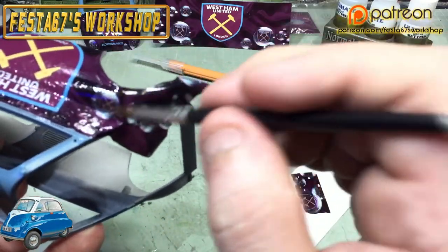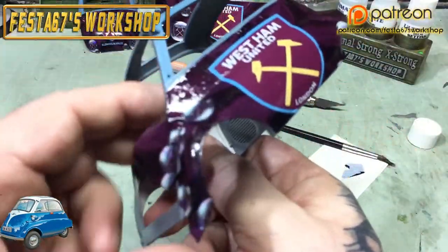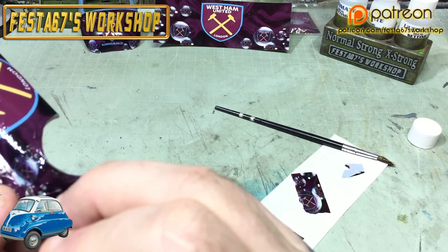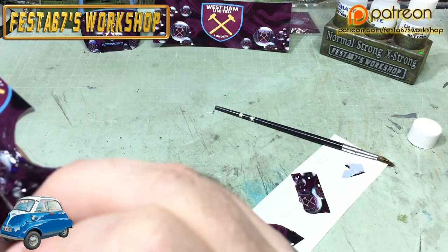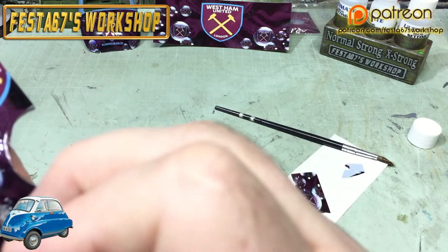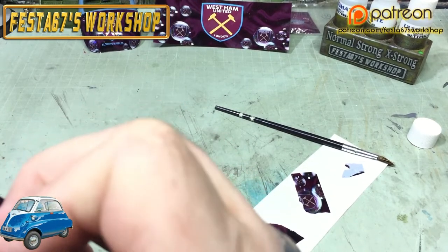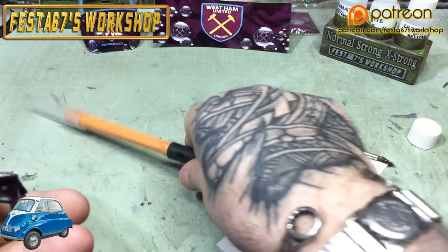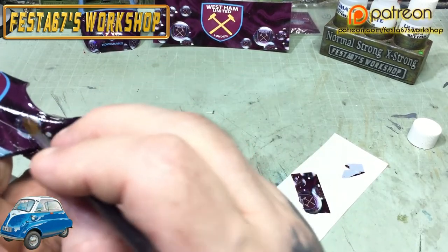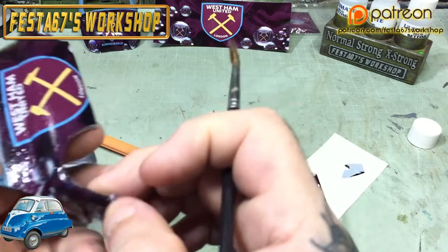So we'll just bring that decal over the front frame now and start dabbing it in place around the contours of that front wheel arch bubble, and we can start then stretching it a bit, because I need to put quite a bit of pressure on it here, because there's a nice big chunky wrinkle around the door hinge. I'm going to cut round the door hinge anyway, and I've got a headlight going on, so I'm not too fussed if that wrinkle stays there, because the headlight's got to go on and it will hide it. So a bit of luck, I'll get it out. But again, in the back of my mind, if I can lose it in an obscure place, then I will. But it seems to be going down anyway, so we might be lucky and not have to do that. But we'll see.